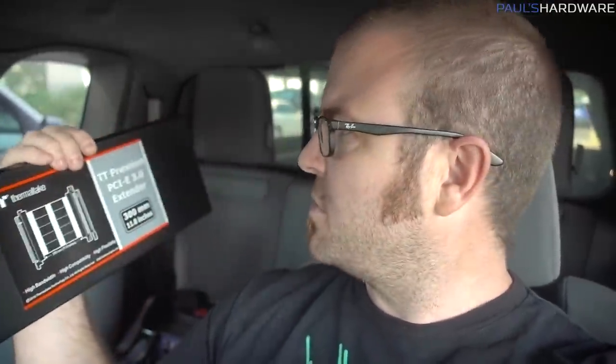Okay, bounced in and out of there pretty quick, but here is what my friends at Thermaltake, and a big thank you to Thermal Mike for meeting up with me and helping out, were able to provide. We got, of course, the PCIe riser cables. These are the 300mm variants, so they're a little bit longer than what I currently have. We got two of the Pacific W1 water blocks, and these are not the newer variants because the new stuff that they make has lots of RGB going on, but these are a little bit smaller, and they've got brackets that I think I might be able to either modify or work with in order to mount these onto the RTX 3090s.